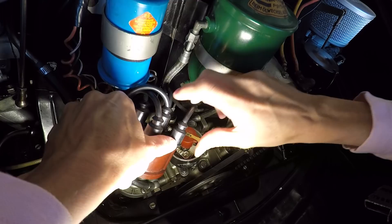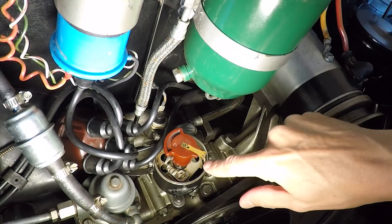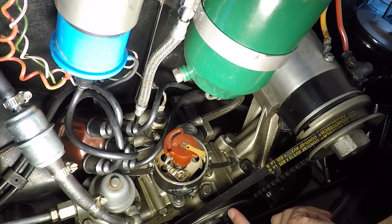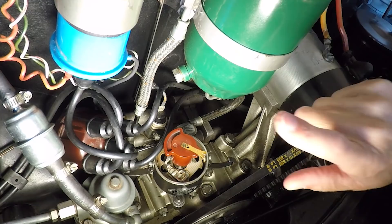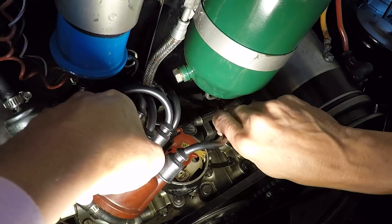We want to double-check the rotor position. There's a little notch down here in the distributor and the rotor is pointing to it — that says top dead center cylinder number one, roughly. We look at the notch on the pulley to be certain, but it's not really critical. All we really need to know is: who are you pointing to? When we put our cap back on, it's this wire.